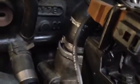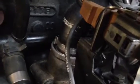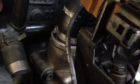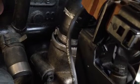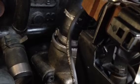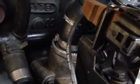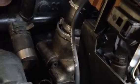It's tough to do with a camera, but it's a little bit easier when you don't have a camera in your hand. And you can see the new 034 Motorsports hose going down into the block there. You need to reuse the factory retaining clip. I broke the plastic breather hose that was coming out. It cracks pretty easily, so don't worry about it. If you have this kit, you're in good shape. So pop that retaining clip out, pop the stock breather hose out. The stock breather hose runs along the bottom here.